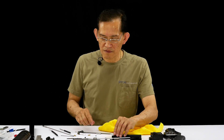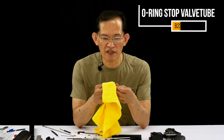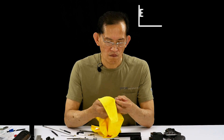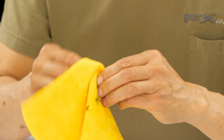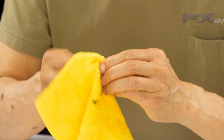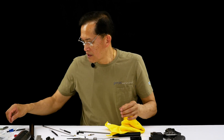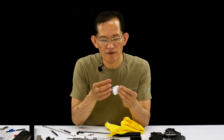You can install the screw on the hex, but this hex could be really dirty also — they put a lot of silicone on this. See how dirty it is. You have to clean it because all this stuff will eventually work itself out and end up in your barrel and cause accuracy issues. Then I clean the ID of this retainer.